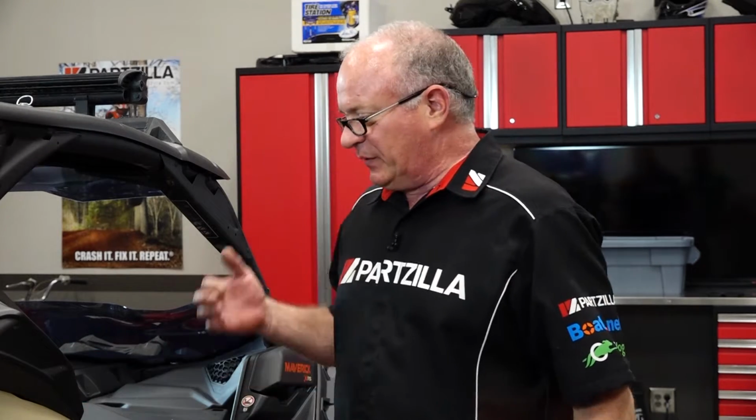All right guys, we're going to dive into this, and step number one is going to be to disconnect the battery. To get to the battery, we need to pull the front passenger seat out, and it'll be located behind it. With the seat completely out of the way, we'll attack that center console, because that's where, of course, all our cabling is going to be run.